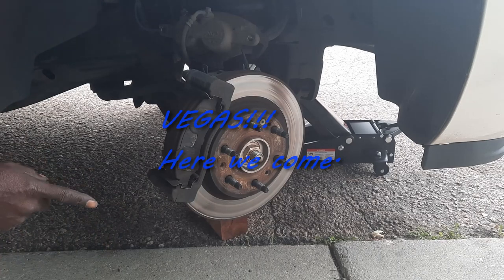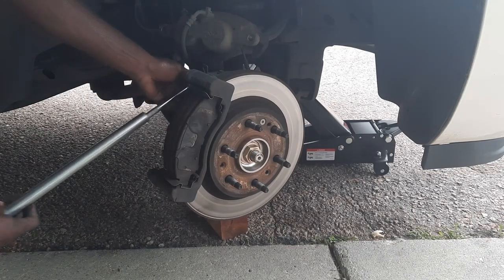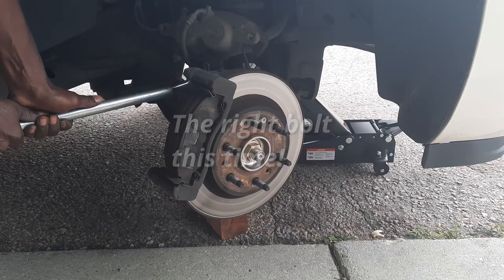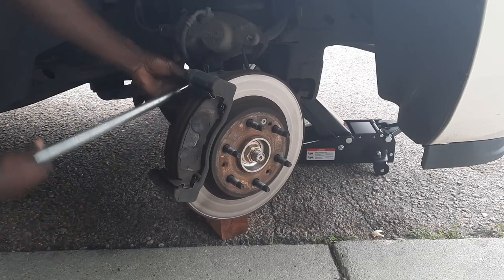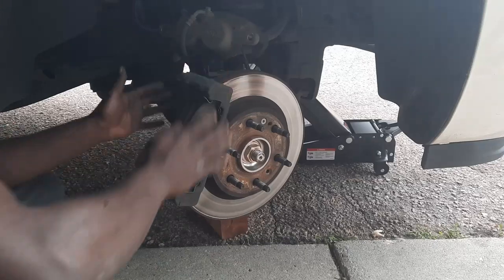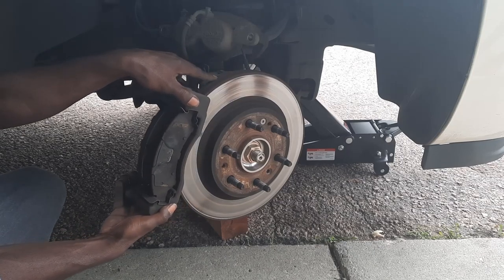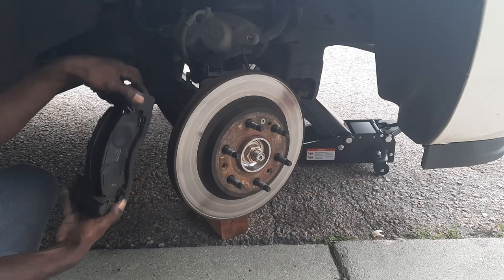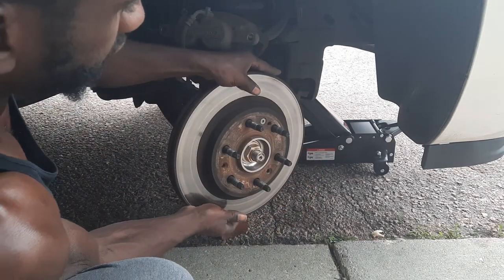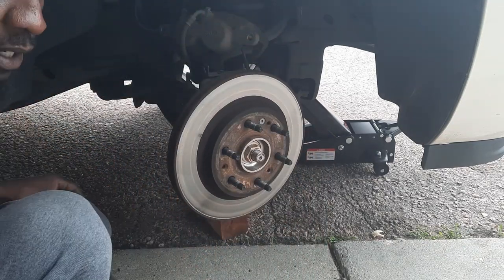See how I started talking and I started taking off the wrong screw just now. So we're going to break off this top caliper nut right here. That's the kind of stuff I'm going to use to finish breaking that and take this off. We removed our last caliper bracket bolt — now what we're going to do is go ahead and pull our caliper bracket actually off. Now we're going to go ahead and grab this rotor — we need that tool to take our rotor off, so we're going to get to that next.